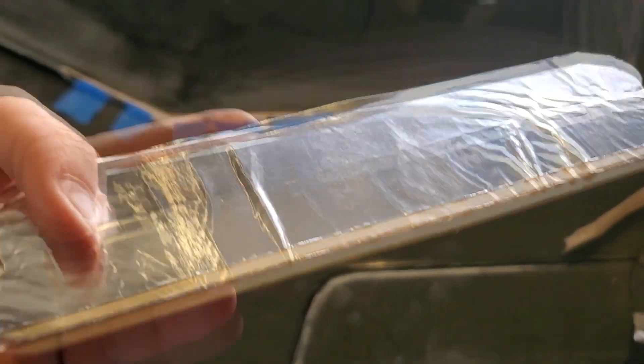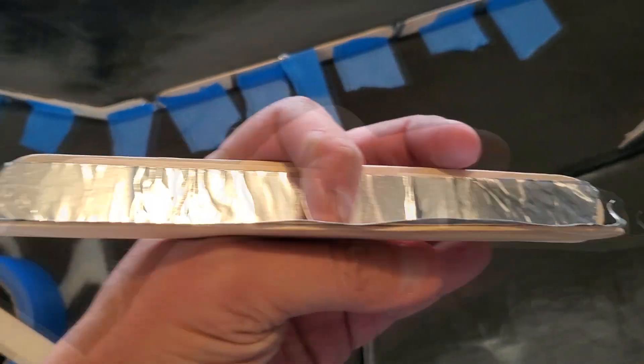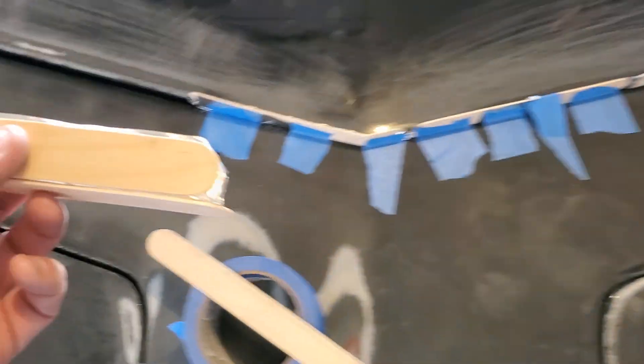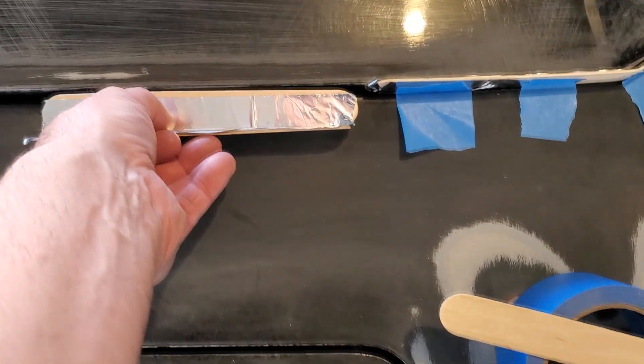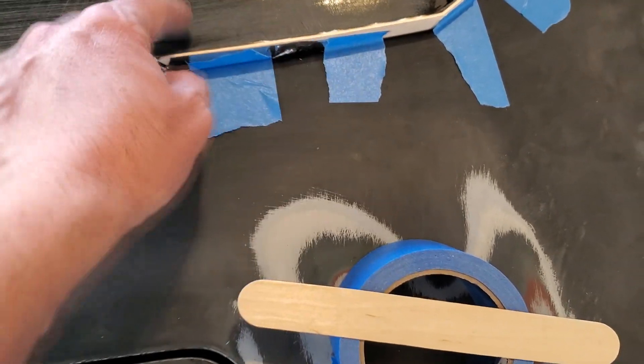That's probably going to work. What I'm doing is taking two sticks, using this aluminum foil tape, bending it like that — and that's going to be my inner channel so I can tuck it underneath there. Then I put tape on the back to hold it to where I have that 90-degree angle, so I'm going to put a little bit of this tape here to hold it in the back to get that 90 degrees. Then I just stuff it down inside like that and tape it just like this, pulling towards the body.